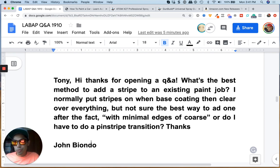Two or three coats of clear coat to finish off your paint job. And then what you could do is actually flow coat that. Wait about a week or two, sand the whole hood down with 800 grit, and put two more coats of clear coat on top of that. That'll basically give you a seamless finish, if that's what you're looking for.